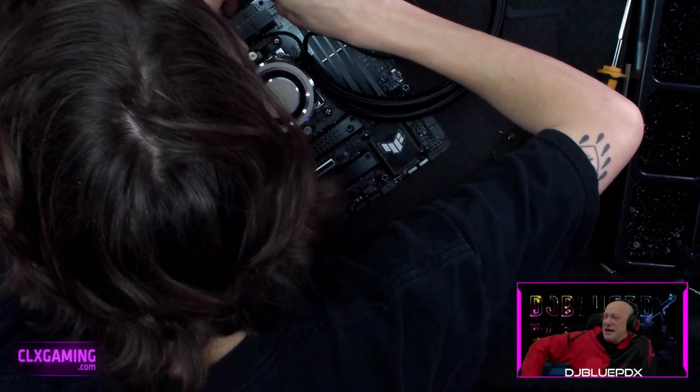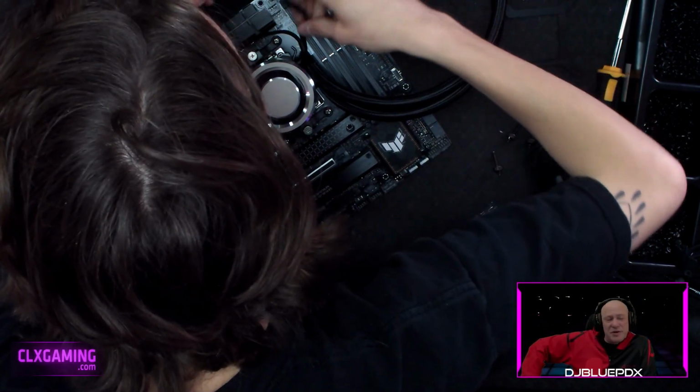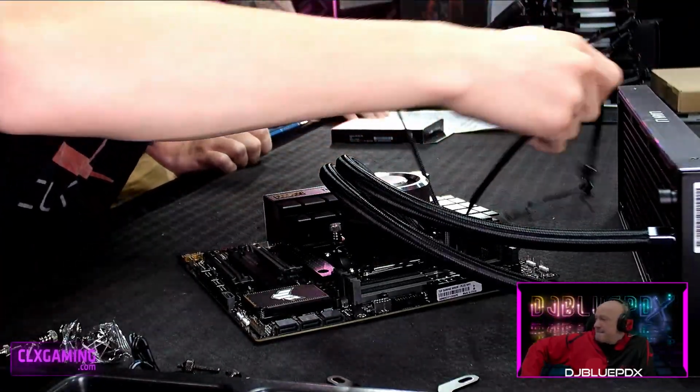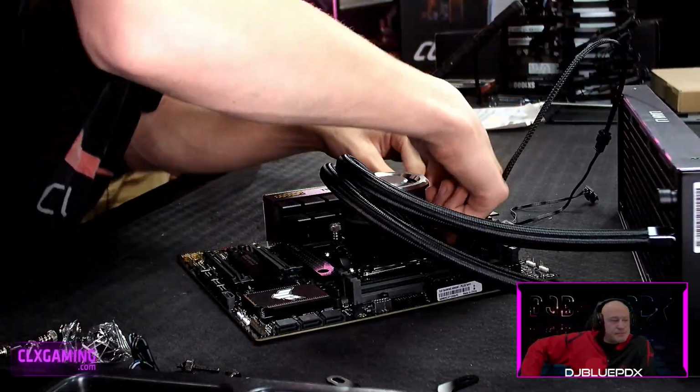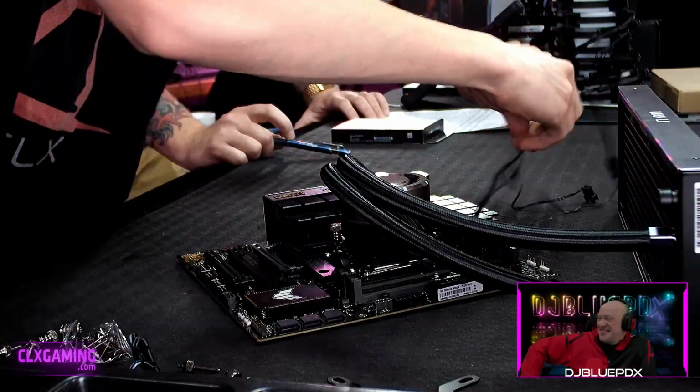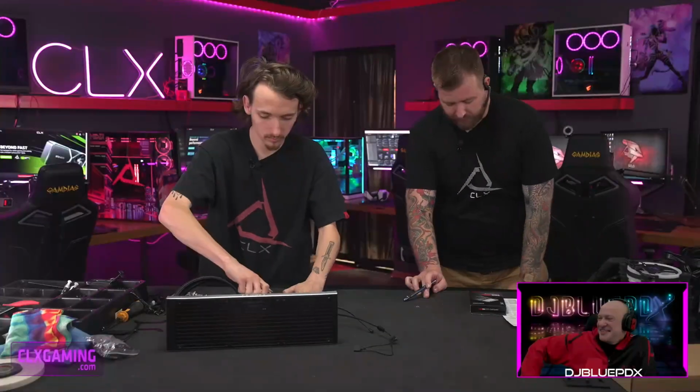Hey asks, is 80 degrees Celsius overheating? Depending on your hardware, if you've got current hardware, honestly, it's not really. We see 80 degrees. If that's while you're gaming, then that's most likely okay. That is definitely getting up there, but everything just runs hotter now. So if that's while you're idling, then I would say you're probably overheating. But in a gaming environment, I think that's probably fine.